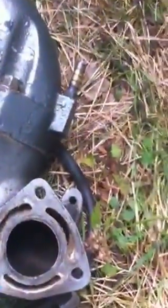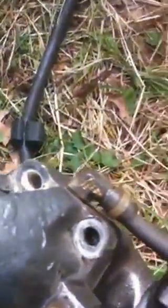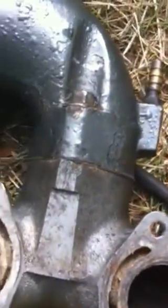I also need to do some work to the exhaust. This is the head pipe here, and this is the exhaust manifold — this lower part. This line right here is where they meet, and I've stripped two of the bolts and they actually sheared out. This third one right here is completely stuck, so I'll probably have to drill all three out to get them out.